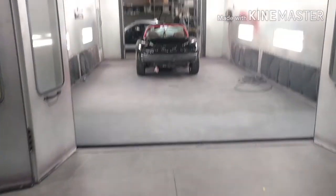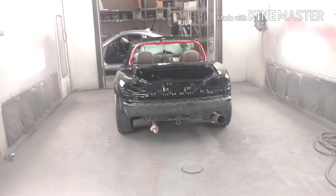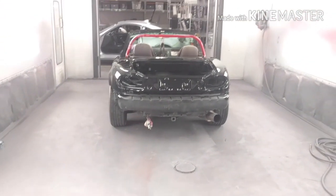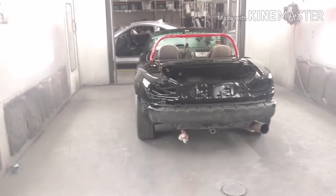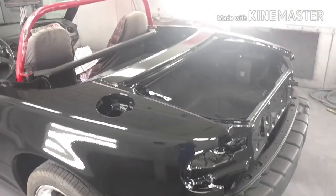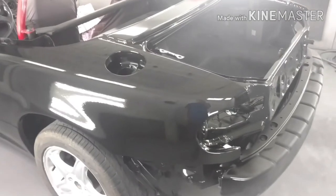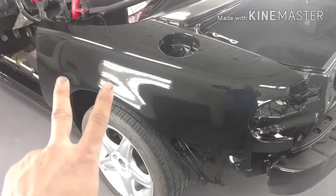The bad part is I bought a whole gallon of paint and I ran out, so I'll have to figure out how to paint match this stuff. I'm gonna polish it and see if a guy at work can paint match it for me and paint it. That's what happens when you paint your car with single stage and you don't let it cure for a week before you spray clear — you make a bunch of sags. I sprayed four coats of clear on this car because I wanted to make sure I got the orange peel leveled out so I can polish it nice and smooth and make it look like glass. Anyway, thanks for watching and I'll see you guys soon — peace.